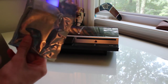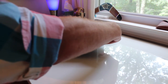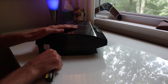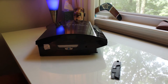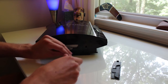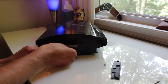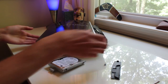I put the drive back in the anti-static bag just to keep it safe. We want to turn the PS3 to the side where the panel is on the left. It took some time to pry it open — I just used a screwdriver. Pry that open and take it out, and as you can see there's the hard drive with the one blue PlayStation screw. Remove that screw and set it aside — don't lose any screws. The hard drive sits inside a chassis and it can be very dusty in there, so clean it if needed.